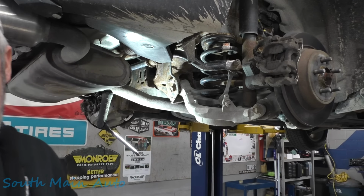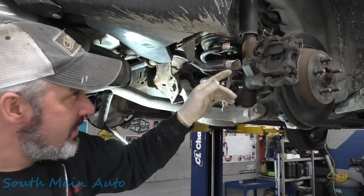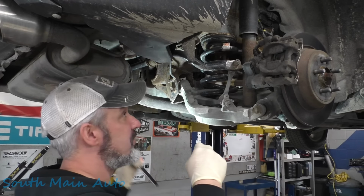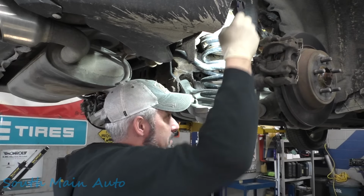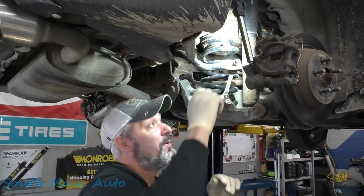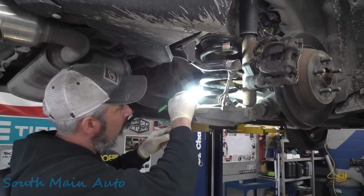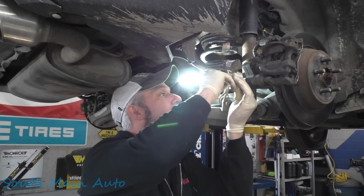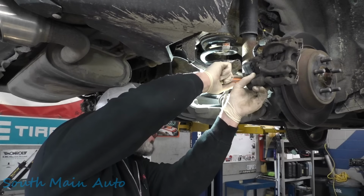And what I wanna know is, can we use a simple test light, a substituted load, to follow our problem if there is one. What I wanna do, my hope and my dream, is to unplug this actuator, if I can get to it, and then put our test light in there. Or do we find out that once we unplug the system and set a code, it shuts the system off? So I wanna learn just a couple things without spending a ton of time.